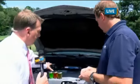Now before we move on to the next thing, in an example like this where we have that cover, some people are just sort of afraid to open up the hood and look in, but we can still more or less find the serpentine belt pretty easily. You can. The serpentine sets down in the front. You'll be able to look down in between and you'll see either some radiator hoses and the belt in the front or on the side of the vehicle, depending if it's a front wheel drive or not. But the serpentine belt's always clearly visible, and so are the radiator hoses.